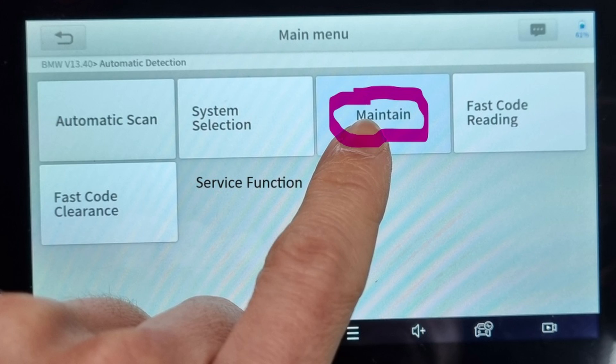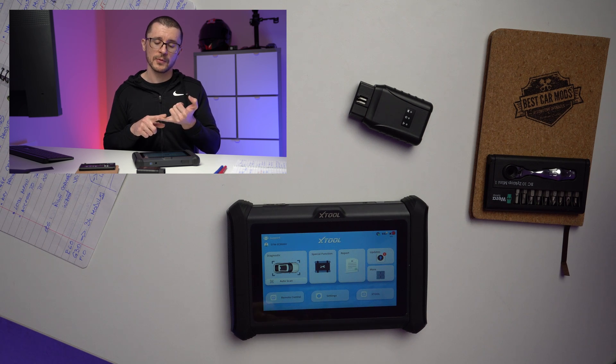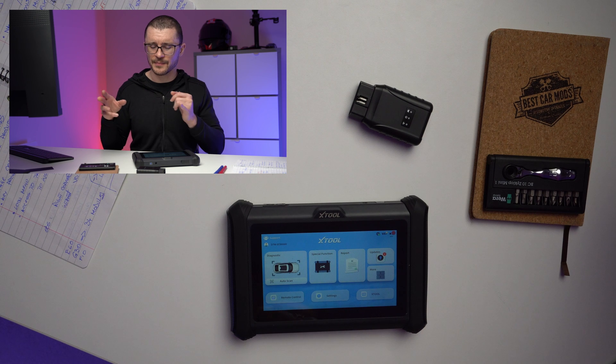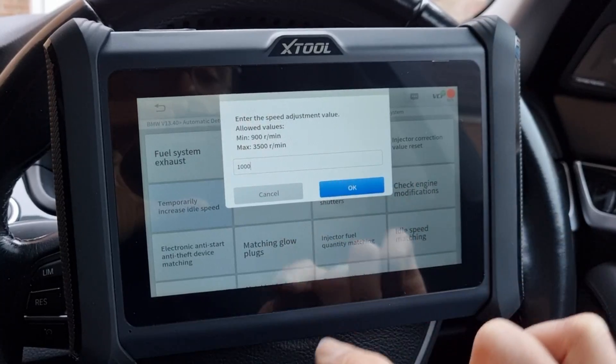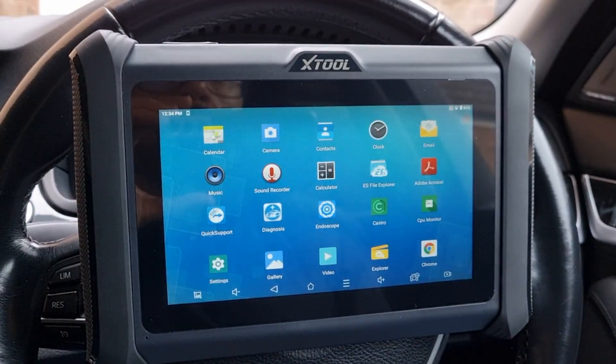On the bad side of things: this tool has labels that are really hard to understand, functions that are really hard to find because the naming and structure is quite awkward, and some of the descriptions for the functions are a little bit iffy. If you continue to use the tool, you will find moments where you try to engage a function and it fails, doesn't work, or even the unit crashes and the vehicle is left in a limbo mode. For example, this unit is not able to do the fuel bleeding procedure on BMWs — you can find a workaround using a different output function, but it's not ideal. I've also used the idle increase function and it crashed, keeping the car's idle increased until I stopped the car — the unit wasn't able to stop it by itself.